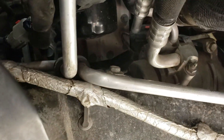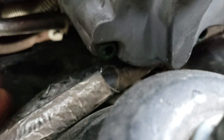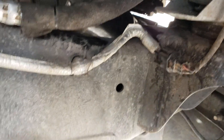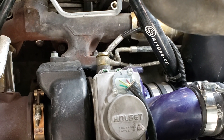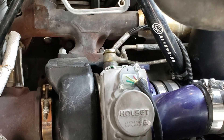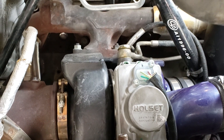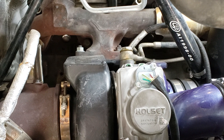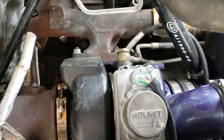So to summarize: three brackets on the transmission lines need to come off, the cords need to go up on top of the shock tower, the transmission lines need to get pushed forward. In my case, I took that fourth bolt off the exhaust manifold on the interior side, unscrewed it, and then there was enough room to attach it once the other three bolts from the turbo side were bolted down.